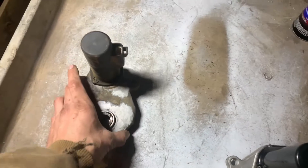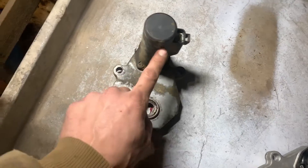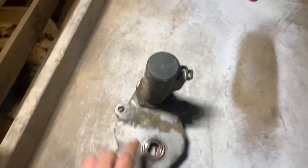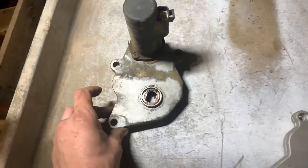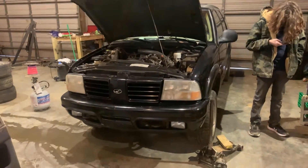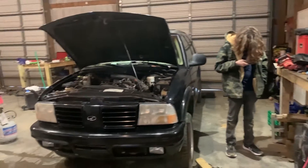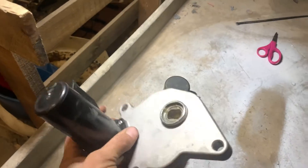Essentially this had gotten seized up — either the motor was failing or it was too caked up. I took it apart, cleaned it, re-lubricated it, but as soon as I reinstalled it, it was popping the fuse again. So I made a custom two-way switch so I can tell the Bravada when I want all-wheel drive and when I want two-wheel drive, without depending on the SmartTrack system. I'm doing away with the SmartTrack system and putting a new transfer case actuator module motor on there.